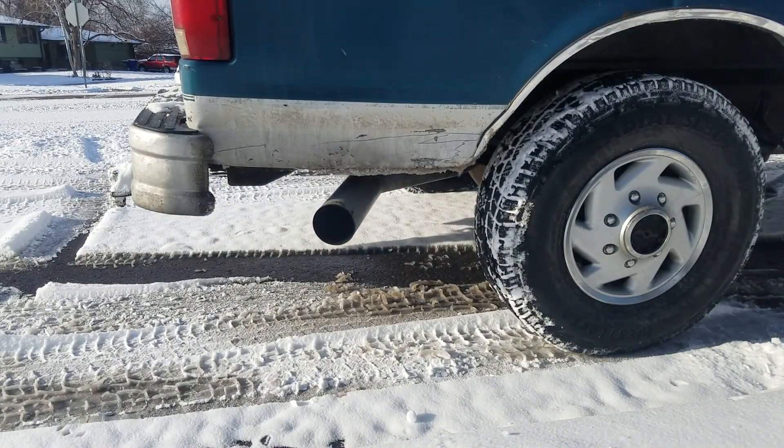I'm liking it pretty good so far. The truck's been warmed up and I'm driving over to my buddy's house. It's zero degrees outside, pretty icy and snowy — this is the biggest snowstorm we've had up here in northern Colorado so far this year. Sorry I can't get any good long hard pulls, but I'll show you what it's like to shift through the gears with this new turbo. Right now I just have a two and a half inch downpipe, it's the stock one but it's been modified — I took out the squash piece, so I have that downpipe into a three inch straight exhaust and a four inch outlet.